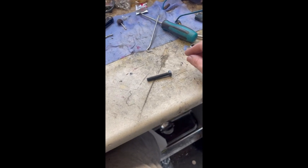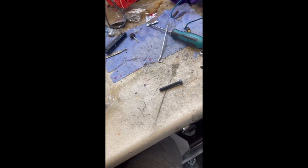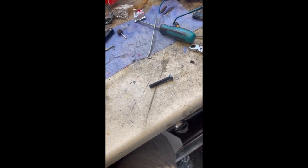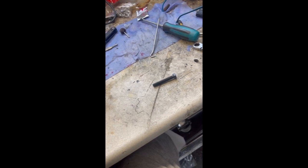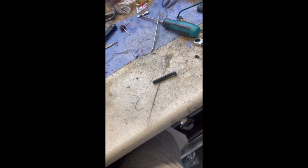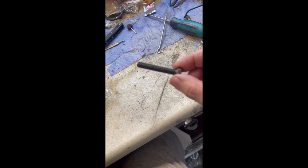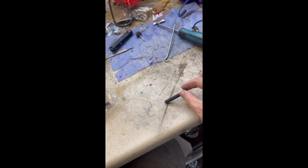Hello, YouTube. It's all buttoned back together, and I used the workshop method of locking the crank. They do it with the engine out. There's no need. On the left hand side of the engine, under the clutch cover, there is an Allen bolt, which looks bigger than the rest. It's an M8, this is an M8.